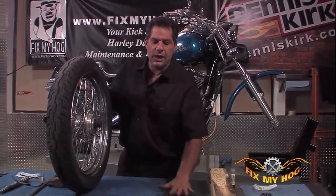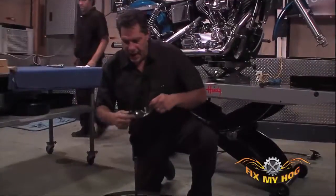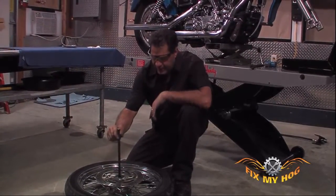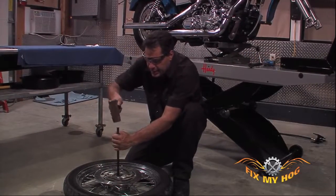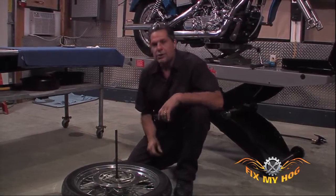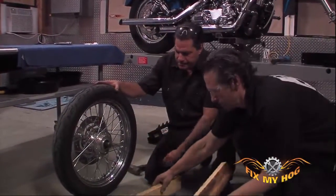I don't want to lose any of my hammering motion through the surface of the bench. Now that the wheel is on the concrete floor, I have my safety glasses on. I've installed the driving handle of the remover into the collet on the other side. I'm going to tap it in till it's good and solid. And now we can try it again. We'll block it up on wood, and we'll try to drive that frozen bearing out of the wheel.